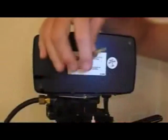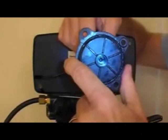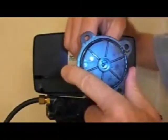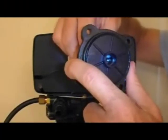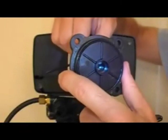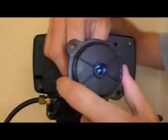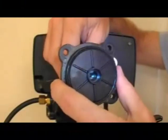What we're going to do is stick the cable back into the hole here, and if you twist it and look inside, you can see there's a small white gear. On a working one, you can apply some torque and that gear will spin freely inside. You're not going to get a lot of twist on this cable — just put a little torque and it will spin, and perhaps even continue to spin for another second after you have applied the torque.